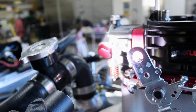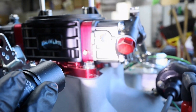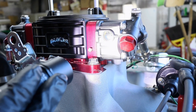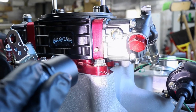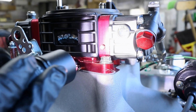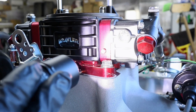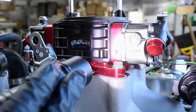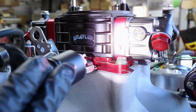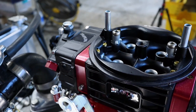Are we doing that for just the primaries or the secondaries as well? It needs just the smallest amount of adjustment in the rear — it's about three-quarters instead of half, so it's fairly close in the rear. We've got quite a bit of adjustment needed for the front. We need the carburetor bowls to be only half full. You need the airflow; otherwise you're creating a vacuum in there and it won't get the proper flow of fuel. That will affect what's coming out of the squirters on top.